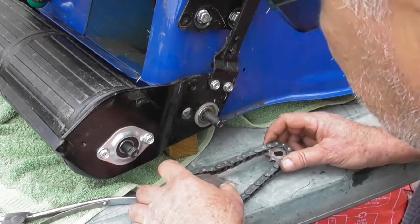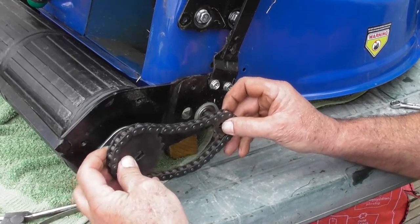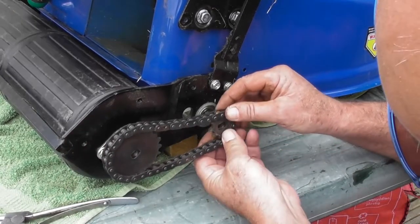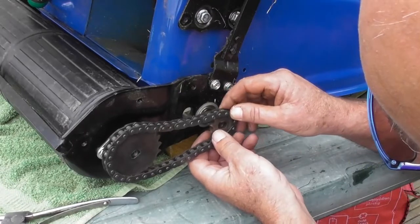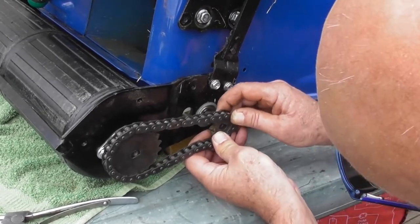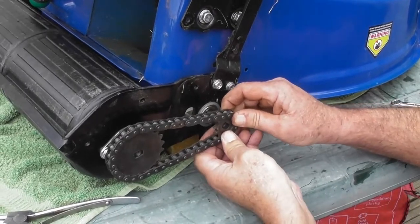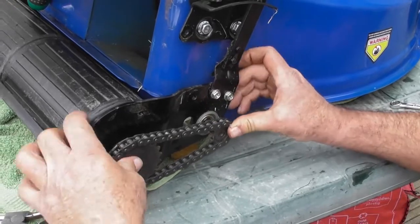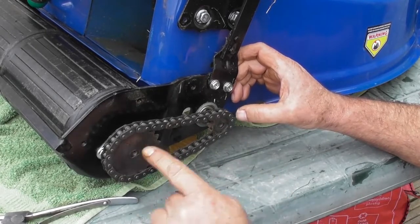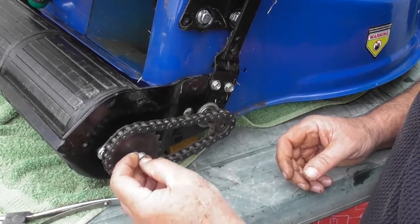So finally, I need to put the sprockets back on. So I need to just play with the alignment slightly, so I can just get the rear one started and then rotate it until this front one lines up with its little keyway, which is not quite, just about there. There we go. So I've got both shafts coming through with the flats lined up with the flats in the two gears. Okay, so on with the screws now.